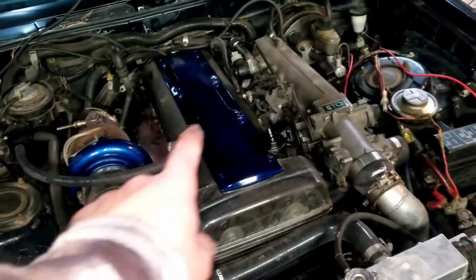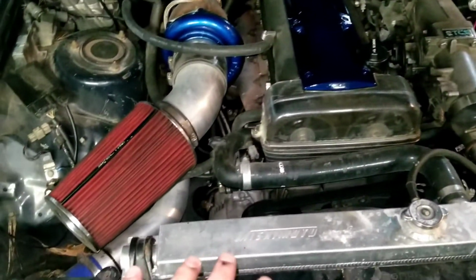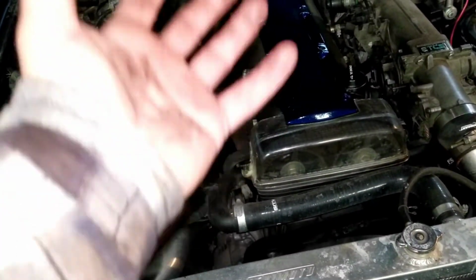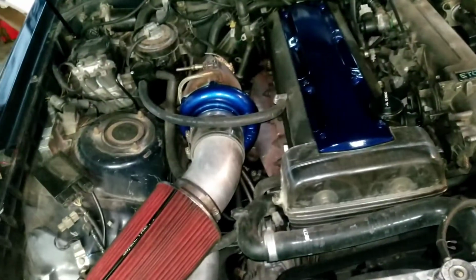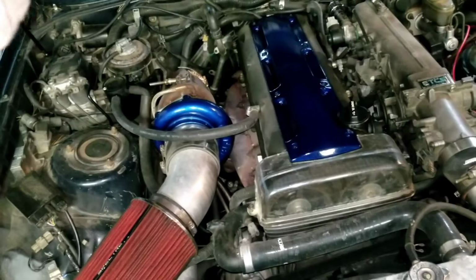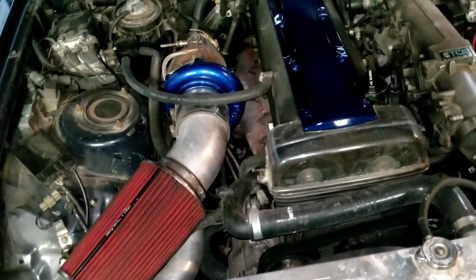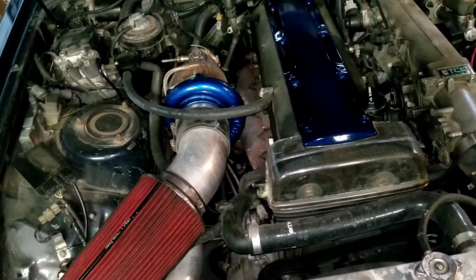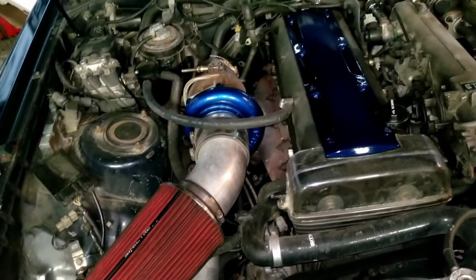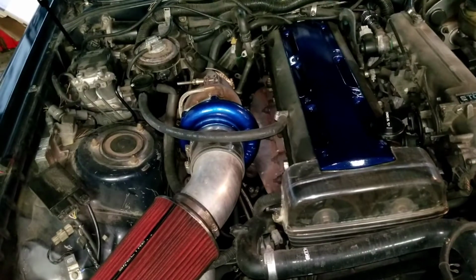The exhaust manifold, the intake manifold. It's going to be a big undertaking, so you have to drain your coolant and get all that stuff out of the way so that you can get to the head bolts, unbolt them, lift the valve train off, and then clean and hopefully not have to resurface the head. My head gasket is not blown, so I'm hoping that it's straight. I'll have my dad check it at his machine shop and make sure that it is, and if it isn't straight, I'll have to get it machined smooth again.